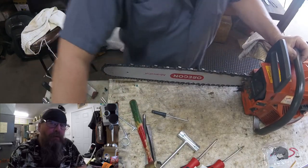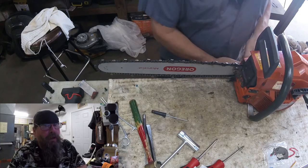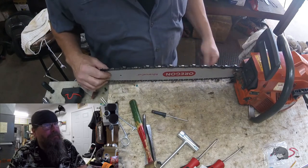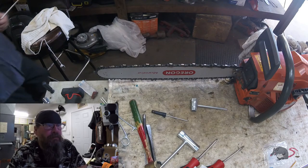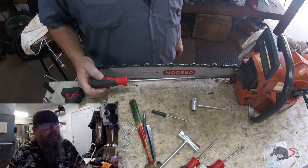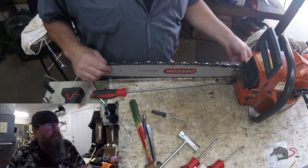Now we're wrapping it up, but you're going to get to see a tool that some people wonder why it's in the toolbox — it's a long cabinet screwdriver. You wouldn't really associate that too much with chainsaw repair, but try using a stubby on this tensioner screw that's tucked between the bar and the felling dogs — it's a pain in the butt. Using one of these long screwdrivers, though, it's a walk in the park. That's why I keep that screwdriver in the box. Anyway, that's all I got for you on the Husqvarna 257 fuel line and trigger repair — thanks for watching.